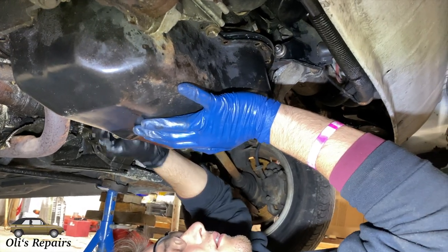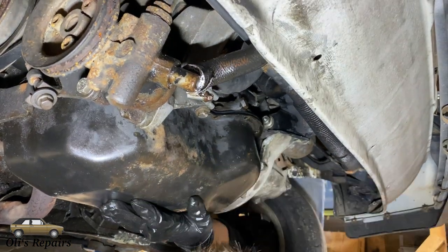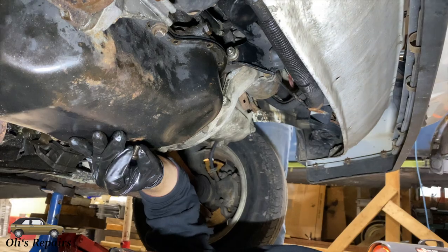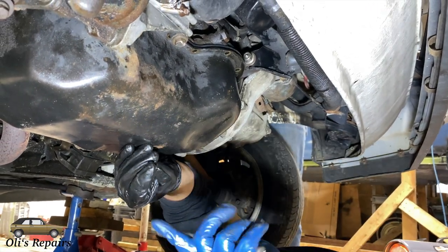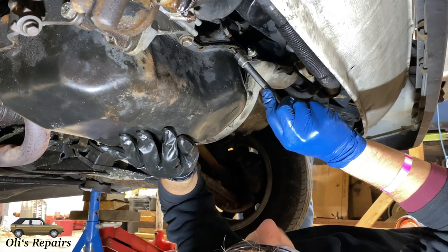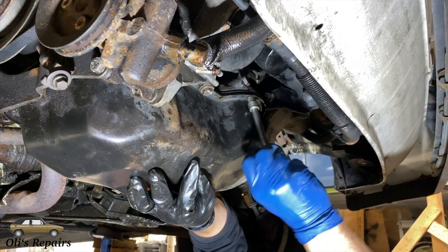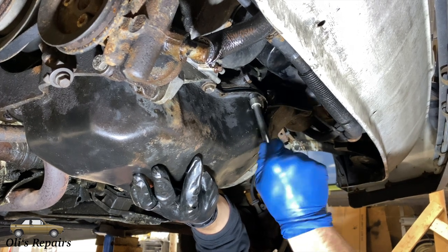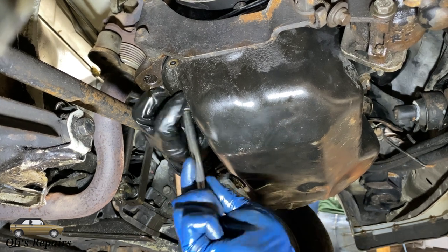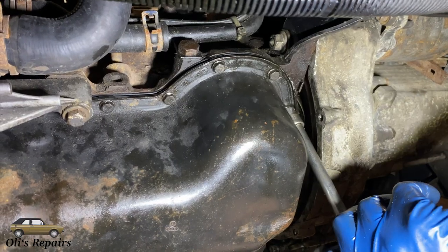The next step is to put the oil pan back on. Slide the gasket around to make sure all of the gasket holes align with the pan holes, then get one of the 10mm screws and carefully screw it in. If you can find someone to assist holding the oil pan it definitely makes the job a little bit easier. After careful alignment of the gasket and the pan, get the first screw started hand tight, then the second screw on the opposite side, followed by tightening all the rest hand tight.